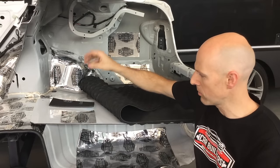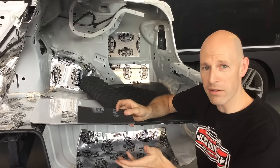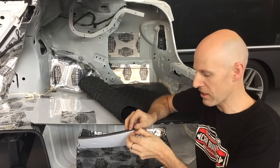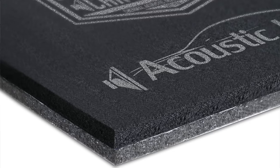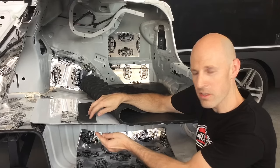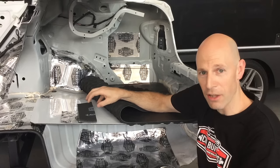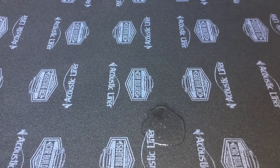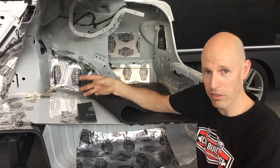That gets stuck to your floor. Second, we've got a range of foams. This one here is our acoustic liner, which is a direct replacement for your cotton jute carpet underlay. It's a peel-and-stick product — peel the back off and stick it down straight over the top. The advantage with this product is it's a twin layer foam: it's got an open cell noise filtering foam and then a closed cell foam on the top. The advantage of having a closed cell foam on top is that if you pour a drink on it, the water is going to sit on top — it's not going to soak into it like your cotton jute.